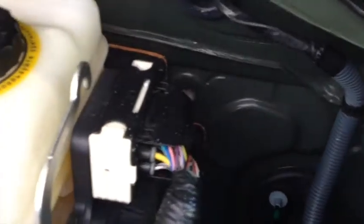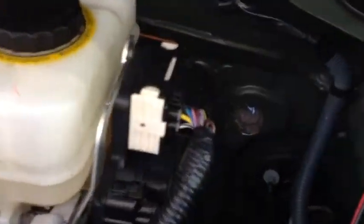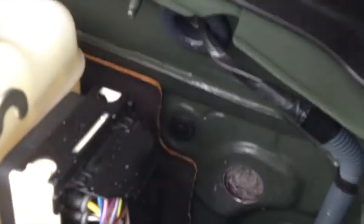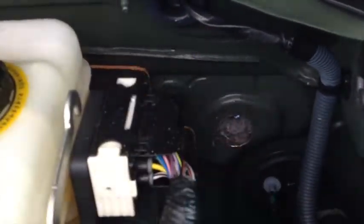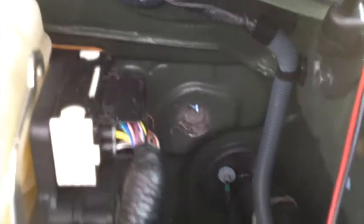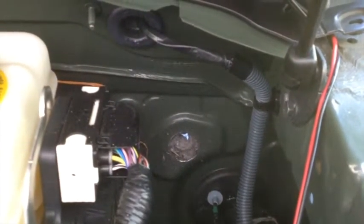One thing is that hole is a lot smaller than the size of that boot, so I'll go ahead and drill it and make it a little larger so I can fit more wires through it. So, a little change of plans. The boot is actually a 1 1/4 inch hole, and that little spot was way too small. So I drilled a new hole. I used one of these big old stepper bits and put a good size 1 1/4 inch hole right there, and there's some daylight going through. I didn't want to cut the other side too big, and it actually looks pretty clean on the other side, so you can barely tell there's a hole there at all.